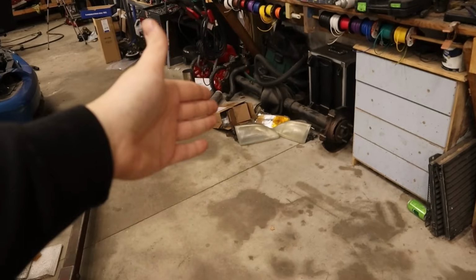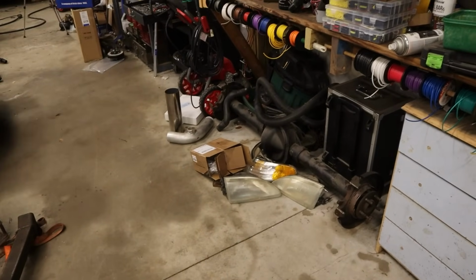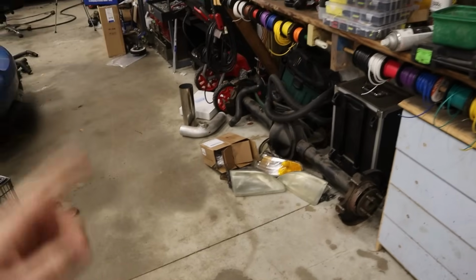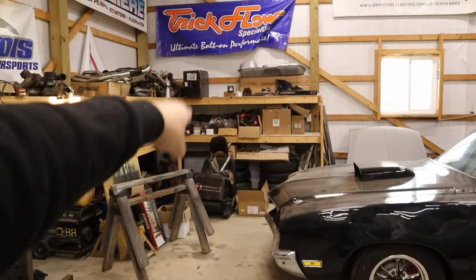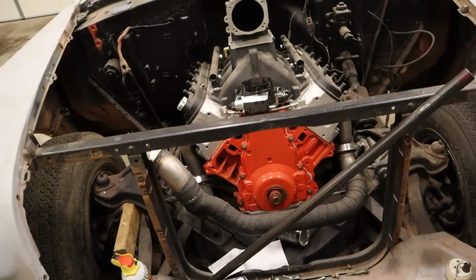The rear, we're going to be putting this Ford 8.8 in it, out of an Explorer cut down, so it's 56.5 inches, give or take, 56, 57. I don't remember offhand, but that's how we're doing our rear disc brakes, nice and easy. For the fronts, we got a conversion kit from Speedway. Everything is in all those boxes over there on the shelf. And once we get all that done, we can throw our new wheels and tires on the front.